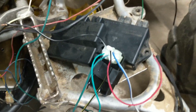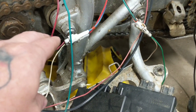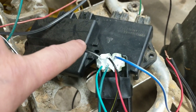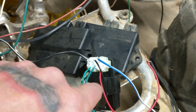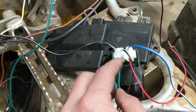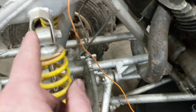So, the finality of it. My trigger wires — I've got one side going to ground, the other side going to the top-left connection. This is the trigger power telling the CDI when it's supposed to fire. We've got two ground wires — they're both tied together and simply grounded. Those are on the bottom of the left connector. This black and yellow wire goes directly to the coil.